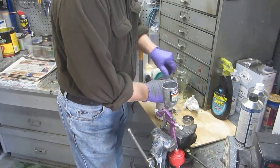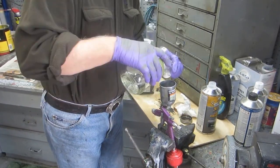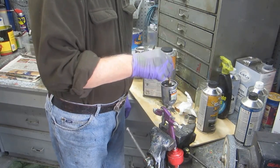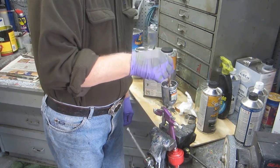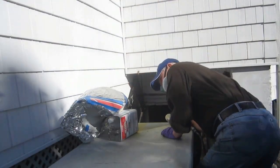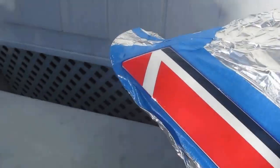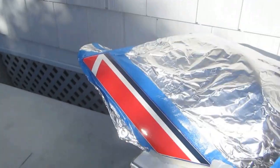The next step was to wait for an appropriate day to spray clear outside. The weather was not cooperating. Mixing the clear up 4 to 1, 5 Star, with fast hardener — we want to use fast hardener on this. The whole idea of putting clear on is not a problem of getting it on; it's where the clear ends. I put some thin coats on, then move the masking tape back just a 64th of an inch each time, so that I don't have one big step — I have a lot of little steps. In the final buffing, that means I can bury that edge and you can't feel it.